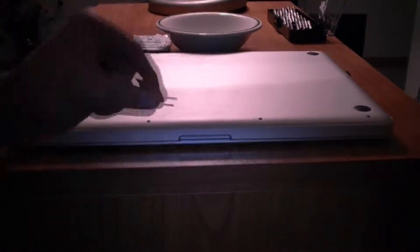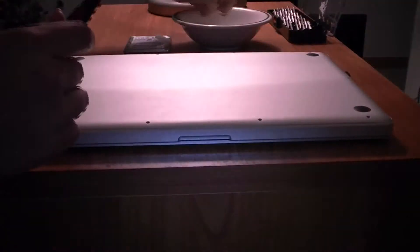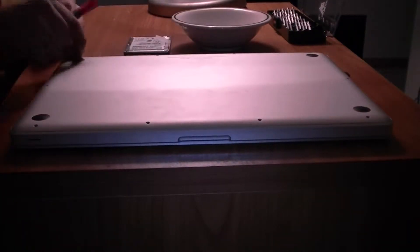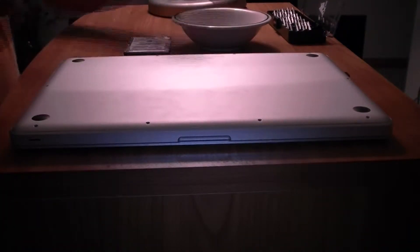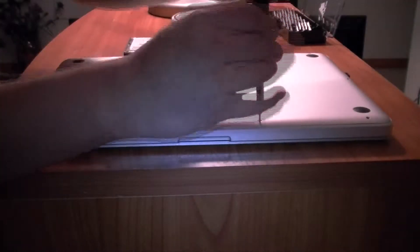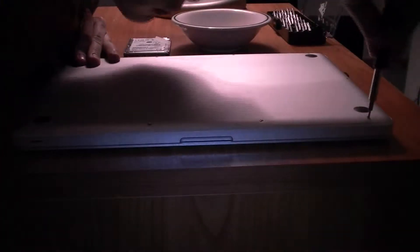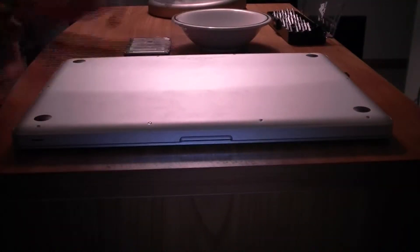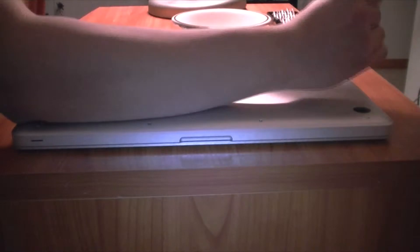Once you do that, you are now ready to fit the MacBook Pro plate back onto your MacBook Pro. Put it back in the right position and press it down smoothly so that it fits on top. Then take your Phillips triple zero screwdriver and start reattaching the screws onto your MacBook Pro. Just remember that three of the screws are longer in size, so make sure you put them in the right screw holes.